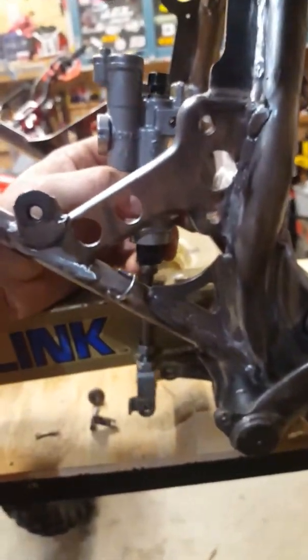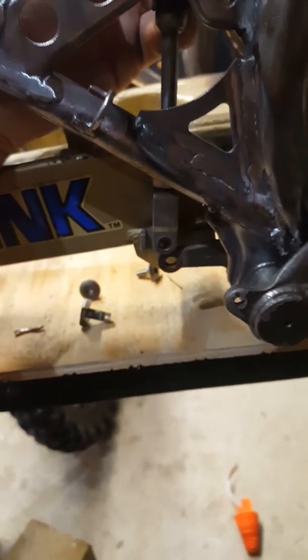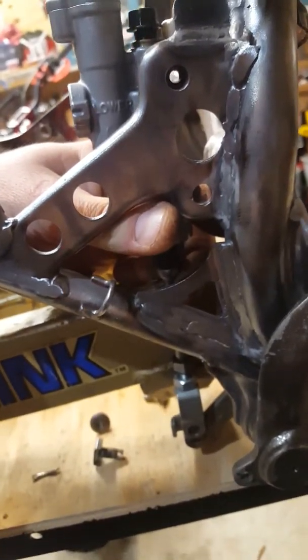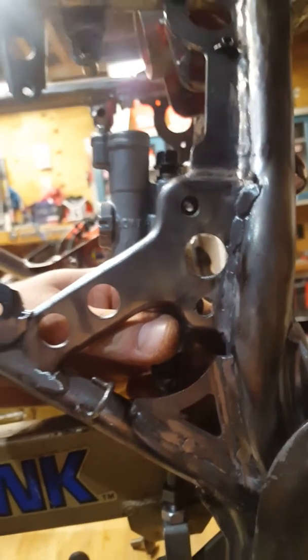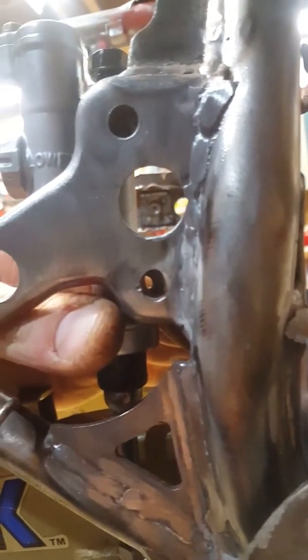I'm still just mocking this up right now so can't really get a good picture of it, but it does look like it's gonna line up okay. I'm thinking I might still be able to use the top hole — I'll have to modify it a little bit — but as you can see, I can line that up and the shaft looks pretty straight. I'll just have to move the bottom hole, which really ain't no big deal. I'll pop that spacer off the back, plug weld this hole up, then make a new spot wherever it goes and put that spacer back on in the right spot.